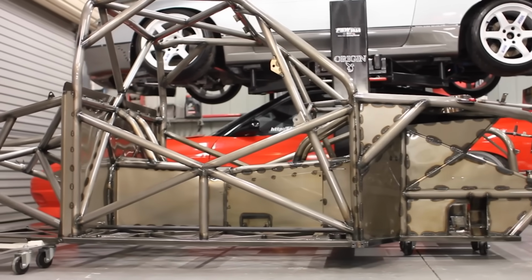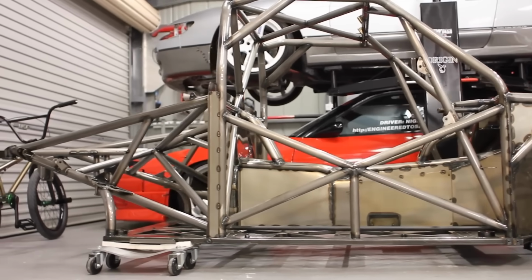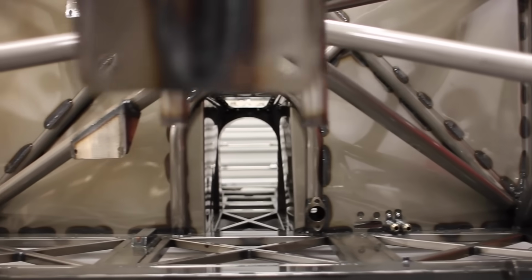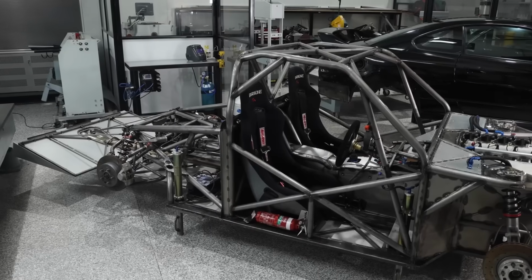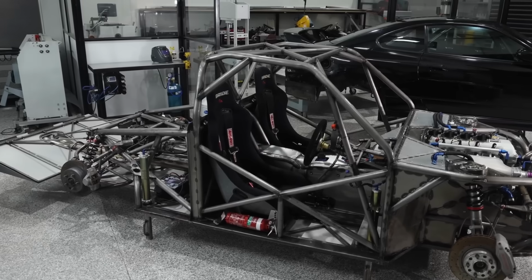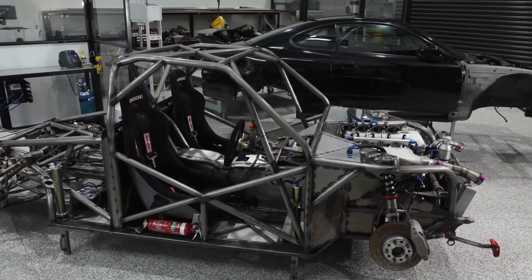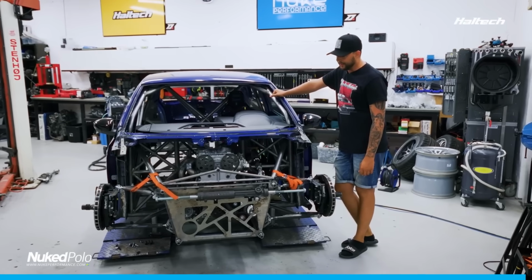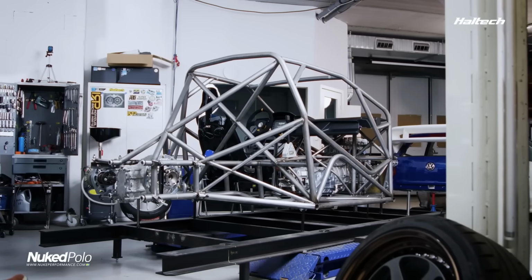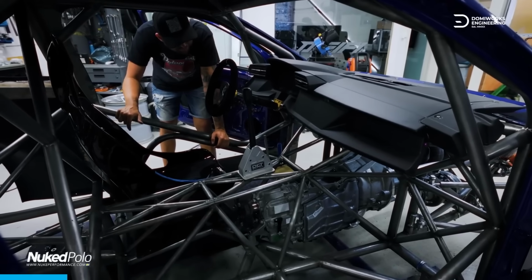As opposed to a ladder chassis or a more common unibody, it uses a space frame for the structure of the car. This is admittedly about as hardcore race car as it gets when it comes to construction methods, but it also yields the highest performance possible, at least with what we're capable of given we can't build a custom carbon monocoque. But it will allow us to build an incredibly lightweight, incredibly rigid, and incredibly safe chassis that will yield an F40 unlike anything else.